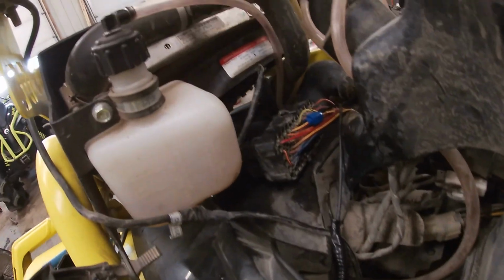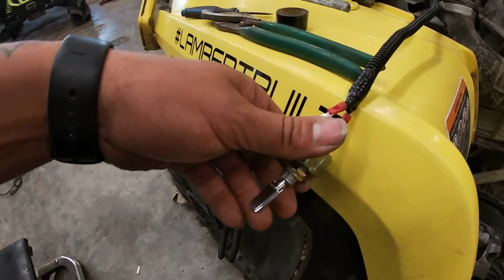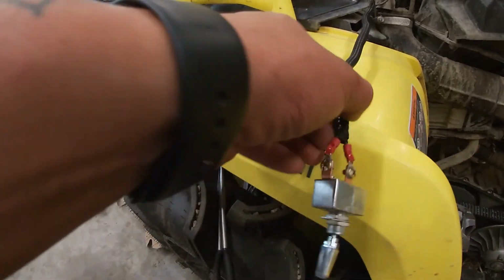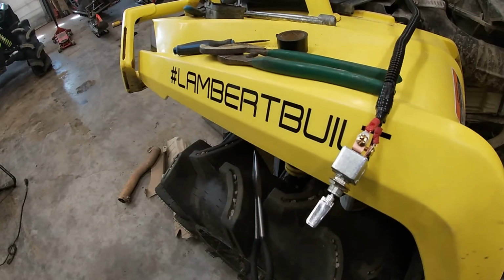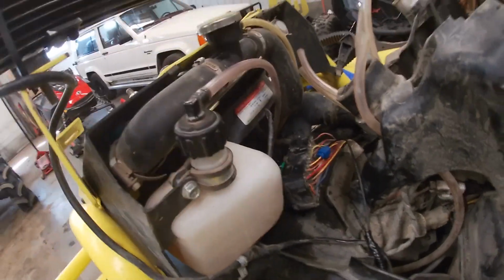I've seen these things come in before, hot wired to the battery. No fuse, no nothing, just a hot wire to the battery. I run it on ACC power, and fuse just for that reason. Like, hot wire is just absolutely nuts. I've seen them run a single wire all the way back to the battery, then you have wire going through your whole motor. This way, there's 2 feet of wire going there, and then there's another foot of wire going down and tapping in. Boom. Underneath here, obviously it's all gonna get cleaned up. Everything's pre-dielectric greased in here, then I tape it to seal it.